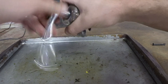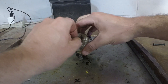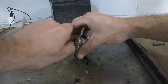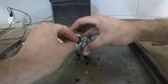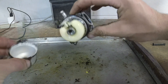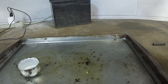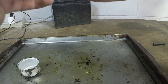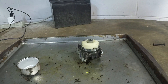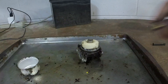I have a feeling it's going to be a little bit of corrosion, but it can't be too bad, right? It still primes. Gaskets are staying — that's good. Actually, it's not bad at all in here. That's great. Okay, that's actually really good. So I'm guessing this jet's just got a clog in it. And it does — that's an easy fix right there.